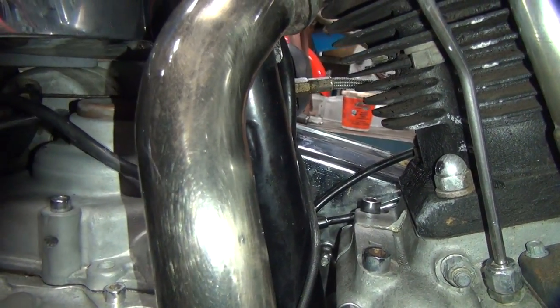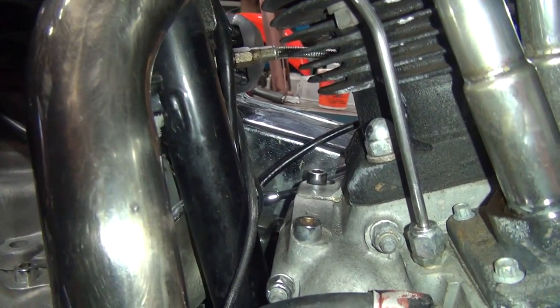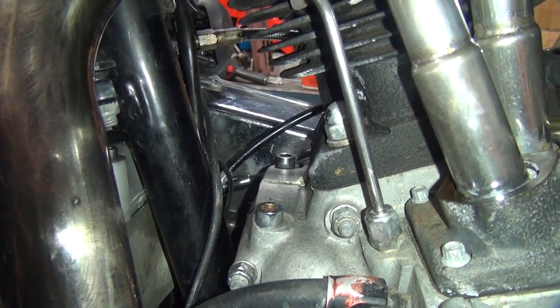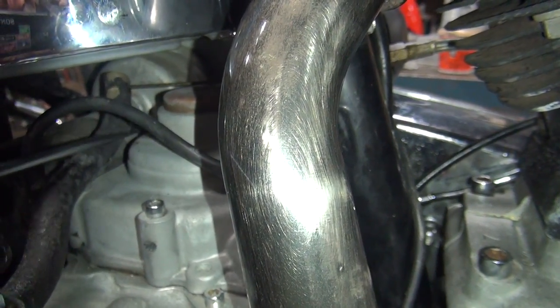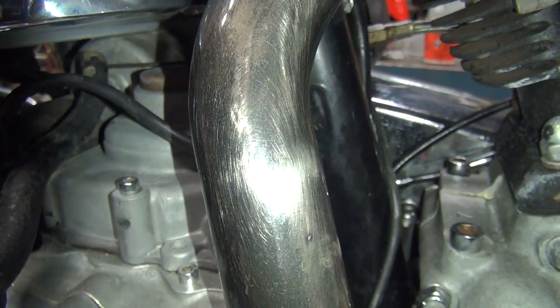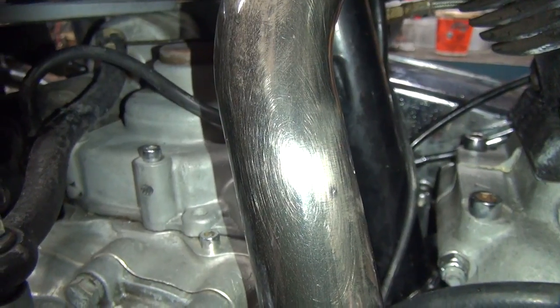Oh, this is a cow pie. You're supposed to be at 13/16 of an inch between here and here. Looks like there's about an inch up in here. So you have to watch with your eyeballs, the camera doesn't work. It's supposed to be 13/16 of an inch. Okay, let me know where it bottoms out when it pulls out. Looks to me like the lever's too low. It does to me too.